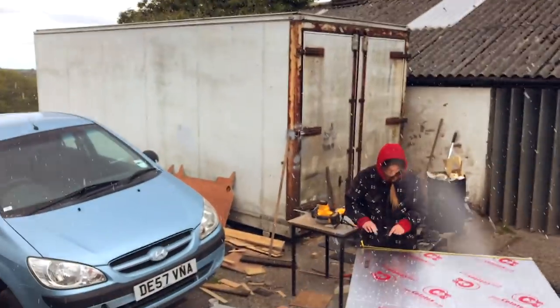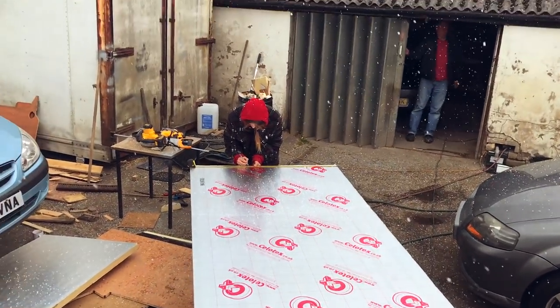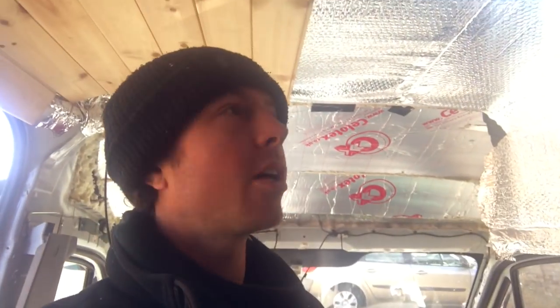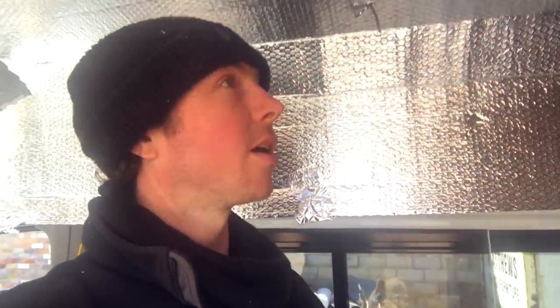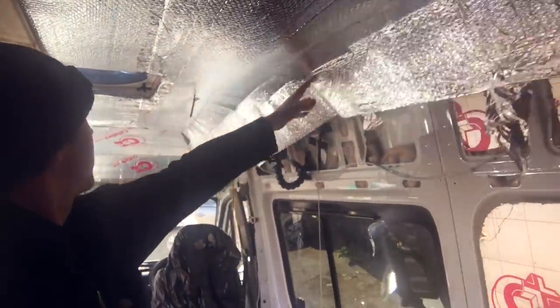It's nearly May. I was having a little think in bed last night and realised that I had forgotten about the cupboards that are going up on the other side. So this morning I've had to pull this insulation down — luckily I haven't put any cladding or anything up yet. I'm currently putting in my favourite rivnuts — trusty little rivnuts — so I'll be able to put a baton all the way down there to attach the cupboard onto, as we did with this side.